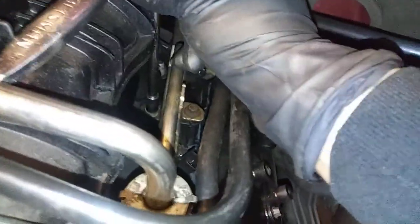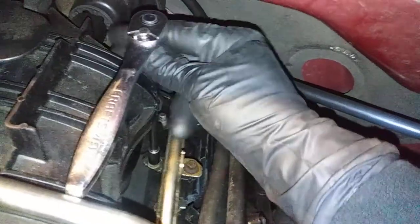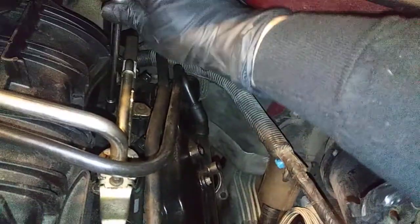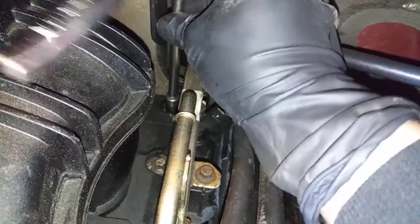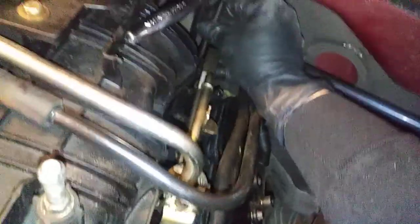But then I would strip it just like that Hyundai. Oh, if you guys have seen that video with me doing the Hyundai, the whole head gasket. He stripped the bolts because he did it with an impact gun, and then he noticed that you only had to have 7 pounds of. Yeah, 7 pounds. 7 foot-pounds. Yeah, but instead he put like 20 pounds on it. I thought it was 140 pounds per, 140 foot-pounds versus 140 inch pounds. It happens, guys. It's just a Hyundai. It's okay. If you guys forgive me, I forgive you. But that car runs, and I need to make another video. Like I said, I'm busy working here and there, but oh man, that car runs like a champ.